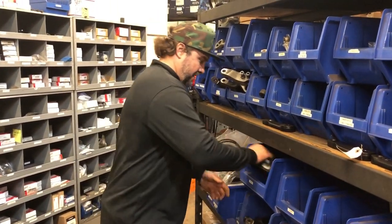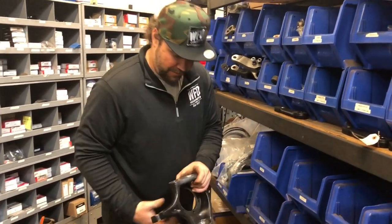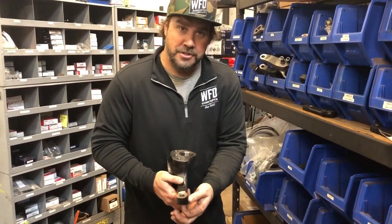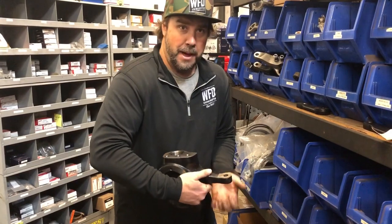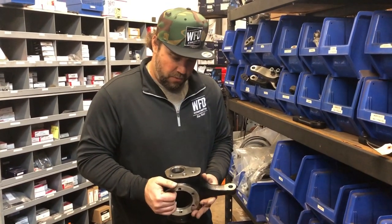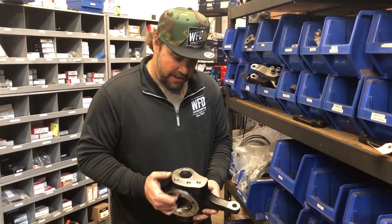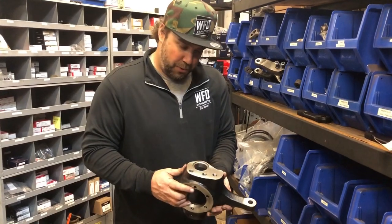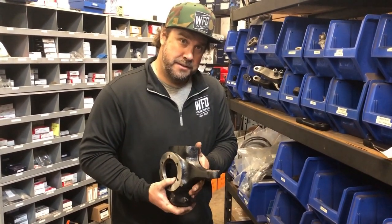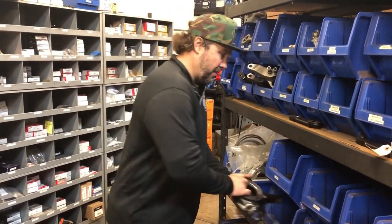This is the 71 to 76 right hand side, because every left hand is already flat top and machined with studs. This is the bottom-up version, so the taper goes from the bottom up and the nut is on top. This would be for your 10 bolts or your late model Dana 44s, meaning 77 to 79 - it's a right-hand bolt-in replacement flat top knuckle. These are $219, so it's a lot easier sometimes to just buy a new knuckle rather than send us yours.